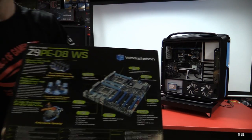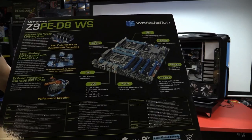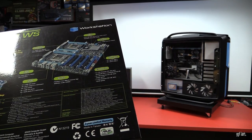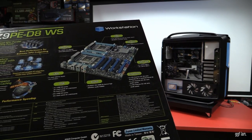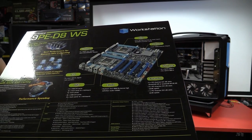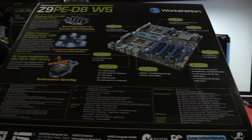Looking at the box, this is a really nice board. I pretty much sold the EVGA and for a little bit more I bought this new. The EVGA still has a fairly large resale price for gamers, probably because of its overclocking capabilities. You cannot overclock on this board — everything is locked — whereas with the EVGA you've got full x58 overclocking features. But for me, not needing 4.5 GHz on every core isn't a huge concern.